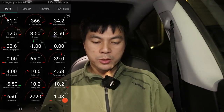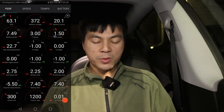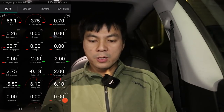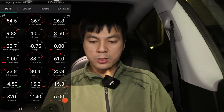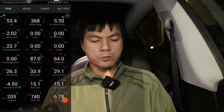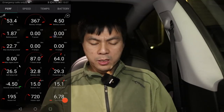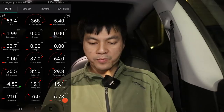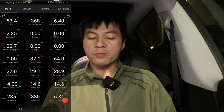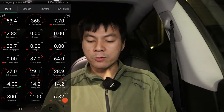You can see the battery heating up. Starting from 3 degrees, we want to know how long it takes and how much energy. We started at 63%. The afterburner shut down after about 40 minutes. There's still some remaining heat in the system finishing the job. So in this case, not plugged in with a cold battery, it takes about 45 minutes to preheat both battery and cabin. If it's not that cold, in most cases you can expect about half an hour.